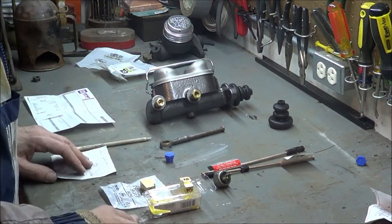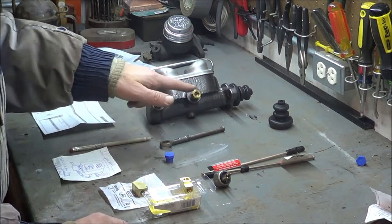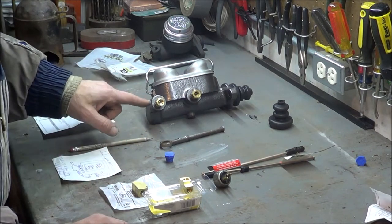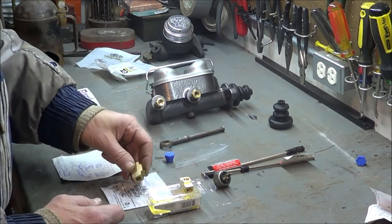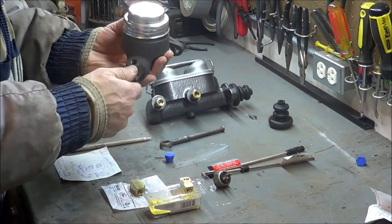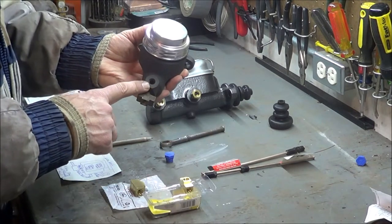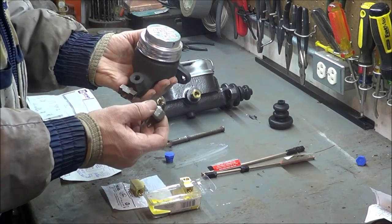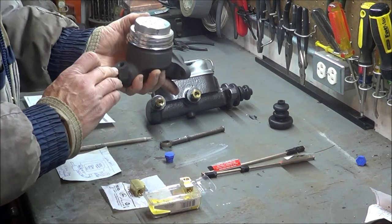You'll also need some additional parts. You're going to need a short length of brake line leading from the reducer fittings into T-fittings that break off to the front brake lines, left and right, and for the rear of the car as well. You'll also need to include the brake light switch. Unlike later Falcons and Mustangs where the brake light switch is on the brake pedal, the switch on this car is on the front of the master cylinder, so I'm going to keep it there.